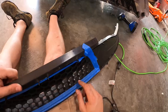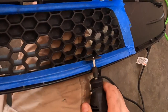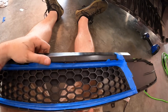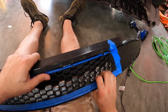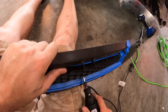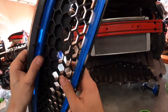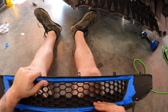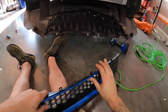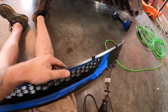Pretty much good to go with lines — using some painters tape to get the edges pretty even. I was contemplating drilling out here to give a little bit more depth, but the problem is the honeycomb actually extends further back than the bottom of the grill. I think the only way to really do this properly is to come straight down. I've got sandpaper so we can make it smooth and look factory at the end. This is really going to aid airflow, especially down here where half of this is closed off — again that's for aerodynamics, but we need to cool off all the power we have.